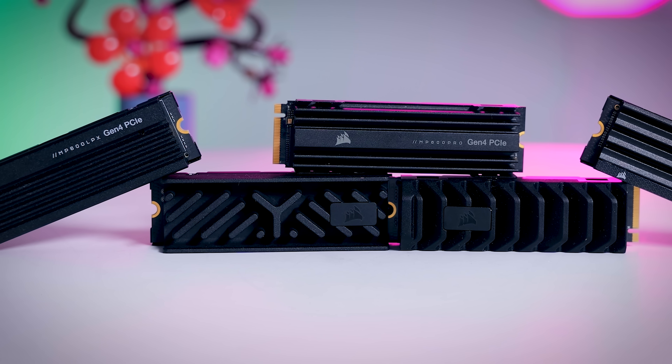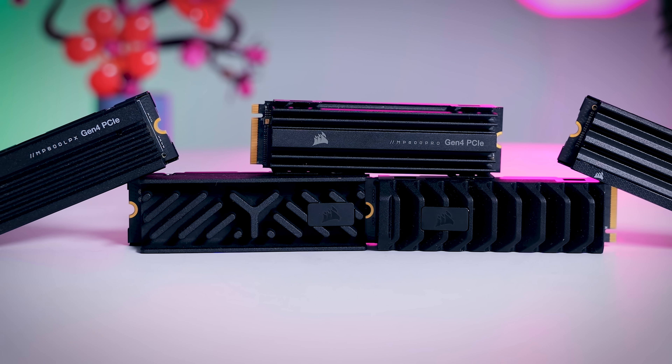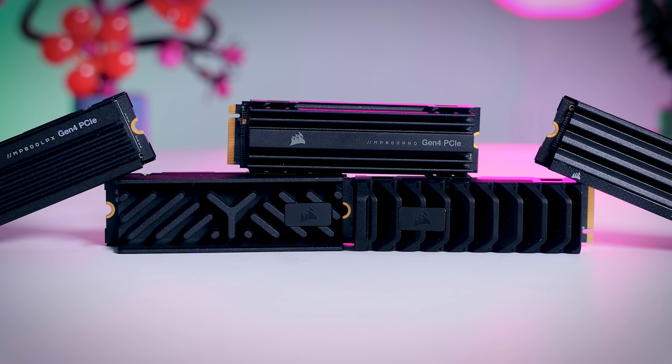QLC SSDs should only be considered if they are actually much cheaper. That being said, we have seen some newer QLC drives that do outperform older TLC drives, and SSD reliability keeps improving every year. So a much older TLC SSD could very well be both slower and less durable than a brand new QLC model. Just like with DRAM cache, my advice would be to not focus too much on the specific type of memory but to use reviews to check performance instead. And just like with DRAM cache, if you're looking for an SSD for a high-end system and expect to really stress your drive, choosing a TLC SSD is definitely the way to go.